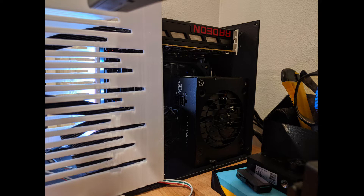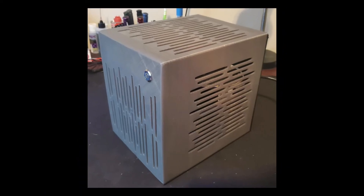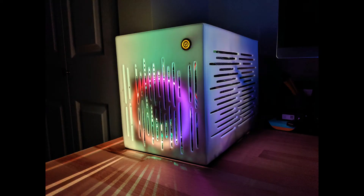Fast forward to 2022, and I came up with this design, which while it is a good deal smaller, it does require a riser cable inside in order to have a GPU. But immediately, one of the first questions was: couldn't you just make a case without the riser cable? And yes, technically I could — it's the same kind of case I just showed. But it would not make it much smaller because a full height GPU is typically much bigger than what you need for the CPU cooler, creating a lot of extra wasted space.